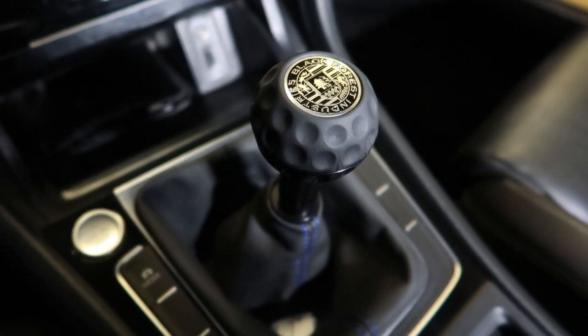Man, it's perfect. All right, well, it's like 4:30 in the morning. I'm finally gonna pull the roommate's car in, get my car jumped. I gotta pull the fuel pump stuff and dry crank it a few times, get the oil through the motor, and then we'll start her up and let her rip. Go for a lap around town. I'm excited. Sun's gonna be up soon. I should probably go to bed, but I got like the next 2.5 weeks off to fix my sleep schedule. So I'll let you guys know about how this pedal feels. Oh, well, it already feels better. Just like this. Nice. All right, let's go for a drive.